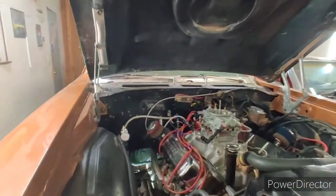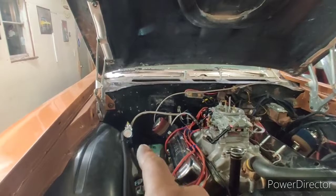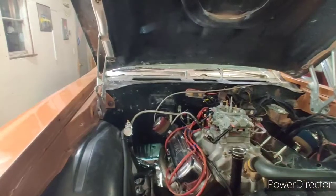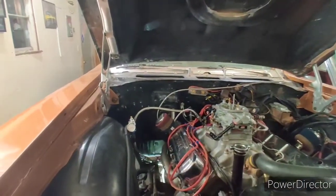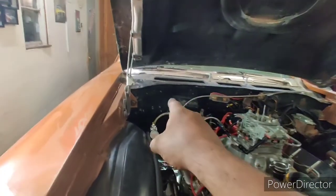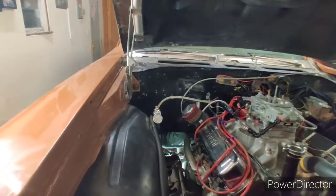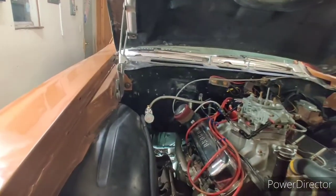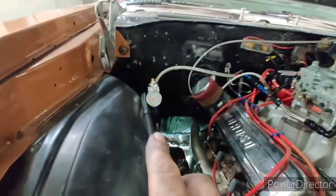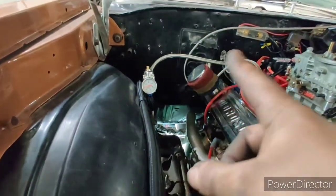This is take two on this video because after I made this video, I sent the picture to JJ and he told me you can't mount your fuel pressure regulator on the wall. Per the rule book — NHRA, whatever sanctioned body you run — you need the fuel regulator six inches away from the firewall. So I moved it from the firewall to the inner wheelhouse, which is plastic. I still have to bolt it in place; I got sheet metal screws in there just holding it. You can see it's my fuel pressure regulator, my gauge running to the back of the log.